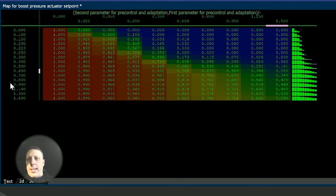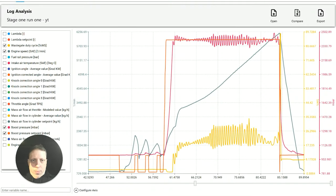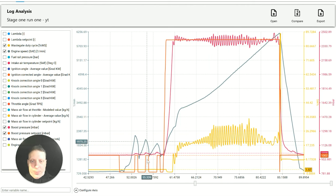The biggest problem with these is the axis data isn't a physical axis data, it's like another model data. So it's like exhaust pressure and all that kind of stuff goes into these axis data. So it doesn't really help. And in the middle it's factored, so 0.66, 66% and all that kind of stuff. So I can go two ways on this. I can either give it more or give it less to try and get it to stabilize. This is all over the shop. Now remember, stock, it was actually okay. It wasn't too far gone. So you can either drop the boost, mess with the PID, or adjust it in the wastegate itself.